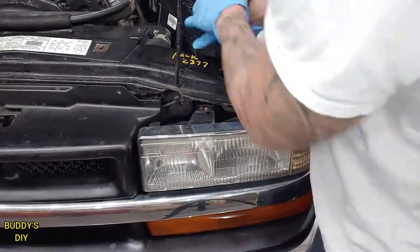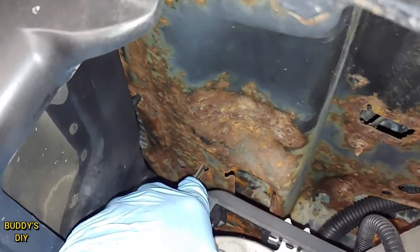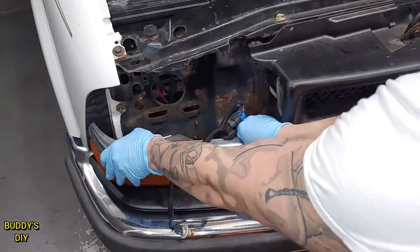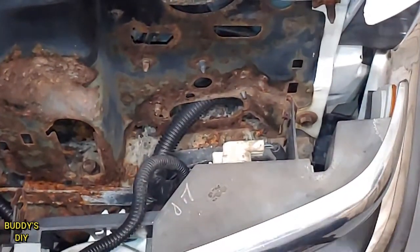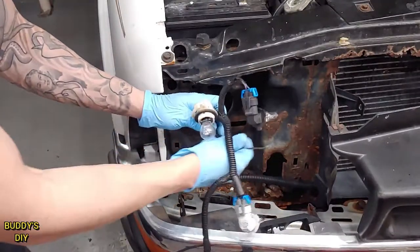It's going to be the same thing on the other side. As we come into the empty headlight housing, you're going to see it does have some clips — one right here, one right here, two right here. Same thing on the other side. To get these clips off, just give it a simple pull. This will give us better access to our blinker bulbs. Same procedure — give it a twist and pull it straight out. I'd recommend taking your bulbs, getting a zip tie, and putting them in their corner all nice and neat.